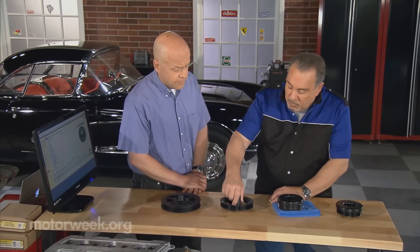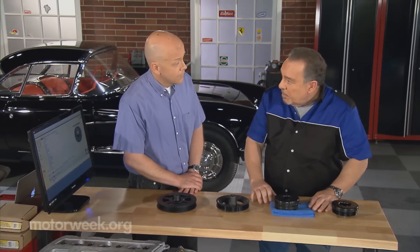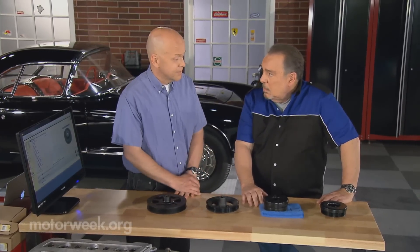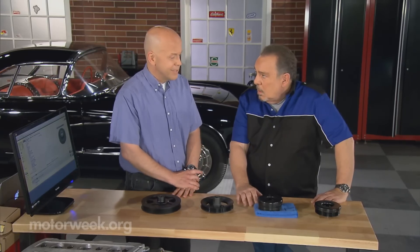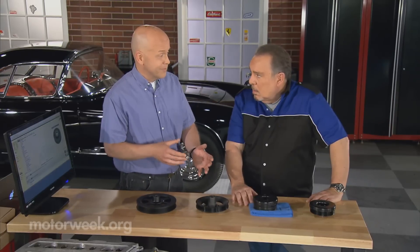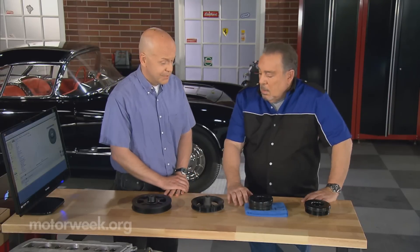Now you find quite a few of these that fail — certain makes, models, and years go through them fairly quickly. The aftermarket ones are often better than the originals. When they fail, it can be a horrific sound coming from the engine. All that vibration you're dampening from the crankshaft doesn't get dampened anymore, so it might sound like a 1980s diesel that is falling apart, even though it's a gasoline engine.